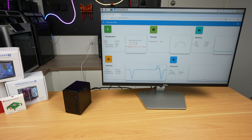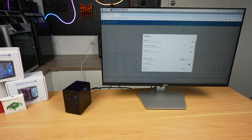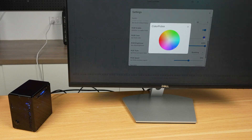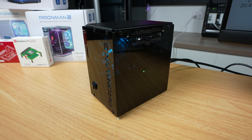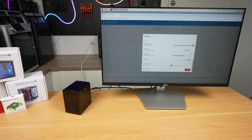Through this dashboard, you can see your system stats, plot graphs of the stats, see logs and modify the case script settings. It's even got some customization options for the display, like choosing which drive and network interface to display, or to flip the display if you're using it upside down. You can also change the color of the RGB lighting and adjust its style and animation speed. There are controls for the two RGB fans and a few modes based on whether you'd like them to be quiet or better at cooling. This is also an improvement over the last case which didn't have PWM fans, so they were either off or on at full speed.